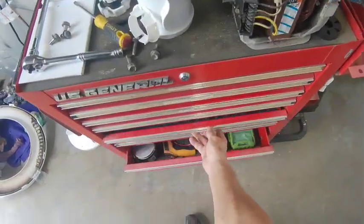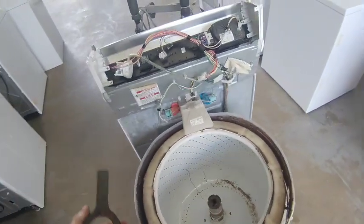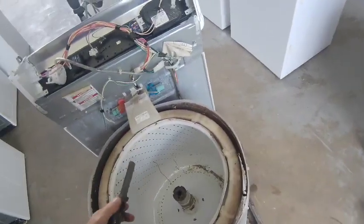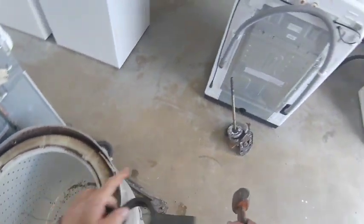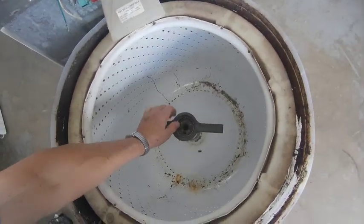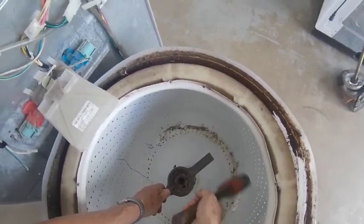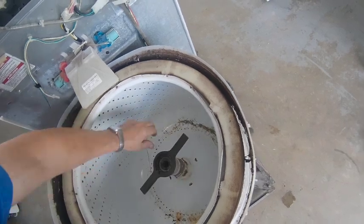This video isn't going to be very long, so I'm going to preface it with a tip on how to remove these tubs. One viewer gave me a comment wondering how to remove these tubs. The way you do it is you get a whirlpool spanner wrench. I've already removed this transmission — that's a transmission that had the agitator stuck on it. I need to remove this tub to change the seal. So you take a hammer — I usually use a two pound hammer and a whirlpool spanner wrench, which you can find in the description — and you loosen it up and take the spanner nut off.